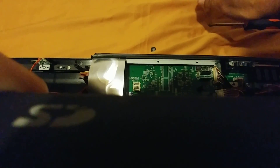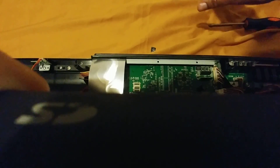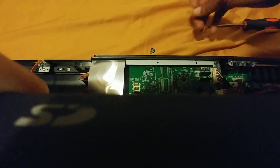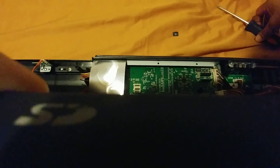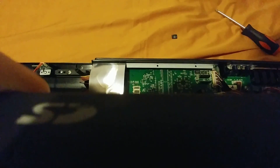If you follow the instructions, they'll have you format another card — class 10, 4 gig or 8 gig — to replace it with. You can get a better card. There's an actual image file that you download; all these instructions are on chromeheaven.com. You download that image file and write it to your blank memory card and that should fix the problem with the noise. My memory card should be finished now so I'll go get it and replace it.